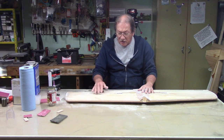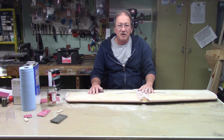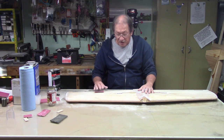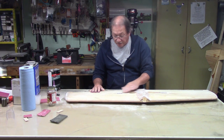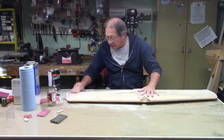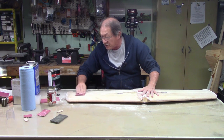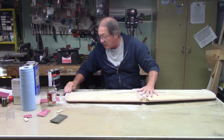And if you have one that's a little bit more than you can sand out, or you have to put on so much primer it's going to take forever, spot glazing putty takes care of that, and that's one application and is good to go. So let me keep going here. And I'll get more into glazing putties when we get closer to putting on the primer.